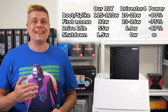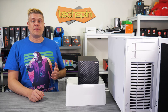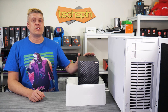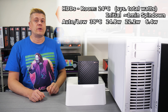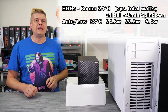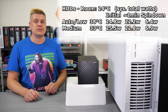We dropped to 75% less power consumption or more than my DIY NAS, which is really fantastic. The fairly silent rear 120mm fan cools the unit. The default auto setting has drive idle temps at 38°C at 22.2W idle, with ambient temp at 24 degrees. Medium speed has a small increase in noise — the drives are 5 degrees cooler at 33°C with 22.8W draw.